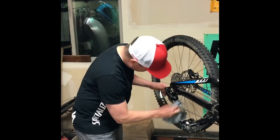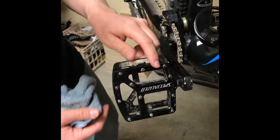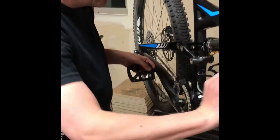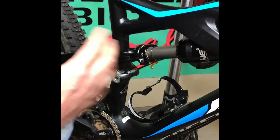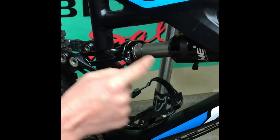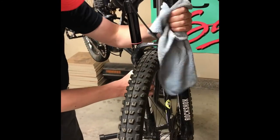Wipe off the components too — get the derailleur and make sure there are no big rock dings from this last season. I also inspect my crank arms. I've got quite a few little rock dings from catching logs or rocks on the trail. I want to make sure those are not cracks that lead into where the spindle is on the pedal, and I look on both sides. I also look over the shock stanchions to make sure there are no dings. If you do find dings on the stanchion, you can use very fine grit sandpaper to wipe off the burrs, because a burr can damage the inner seals as the shock cycles. I check both the rear shock and then come up to the front shock, wipe it down, and make sure there are no burrs from a rock chip.